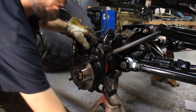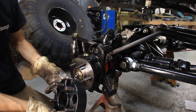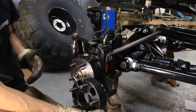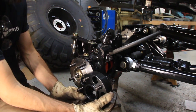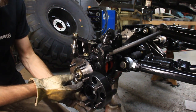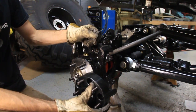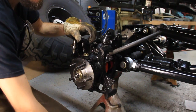In this case, I'm going to be running some spacers and my wheel studs weren't long enough. By the time I got my brakes on and then the wheel spacers, I didn't have enough room to get my lug nuts on. There was probably only a couple of threads that would go on, and the lug nut wouldn't go all the way down on the thread. So I need to get longer wheel studs, and I did that.